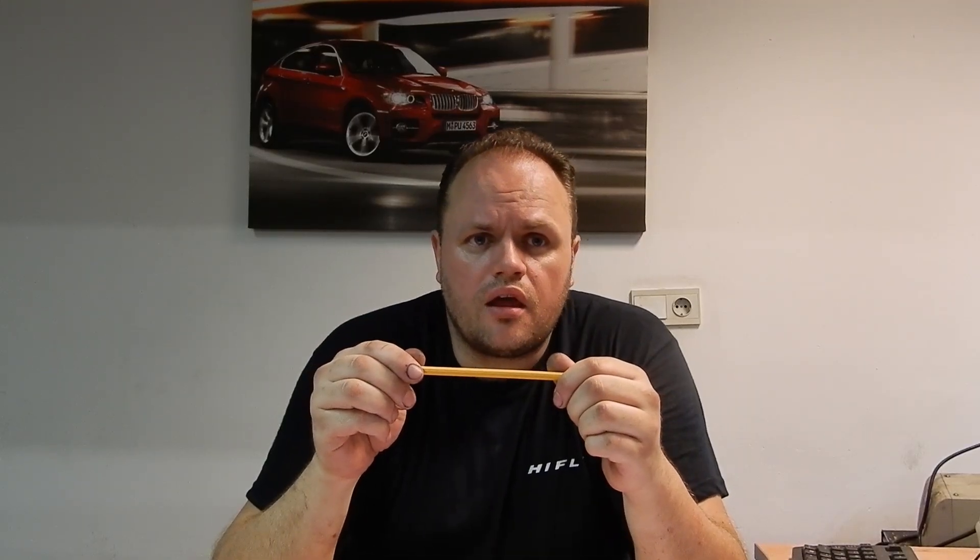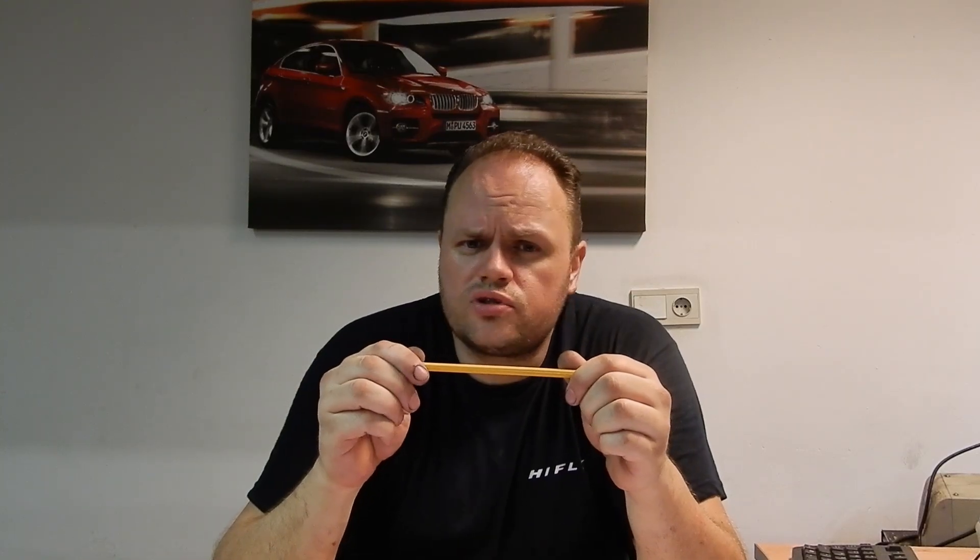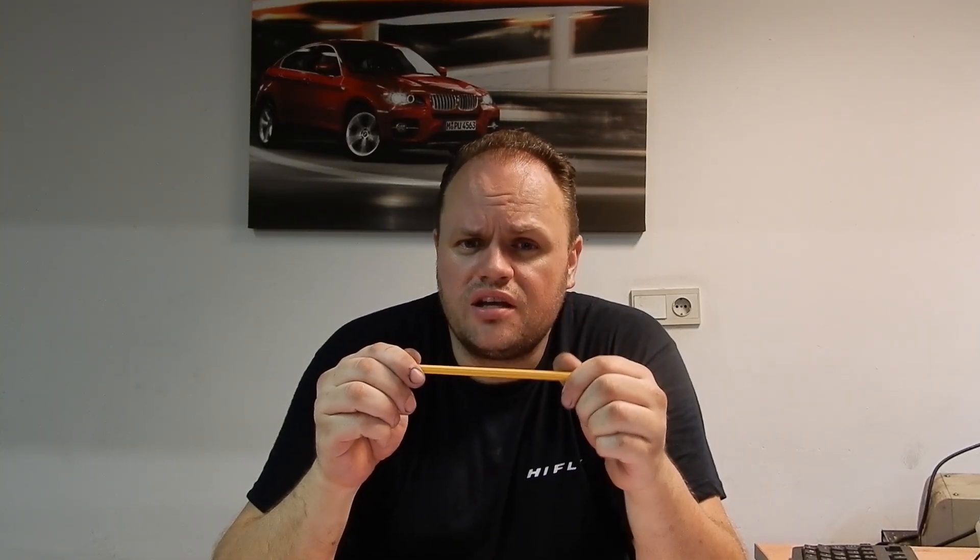Let's think about this. Remember at the beginning I said it looked like the battery was weak and I connected the battery charger — well, actually it wasn't. It was a brand new battery; the previous garage had already installed a brand new battery, and even the starter motor was replaced. Another thing I learned today: it's called a relative compression test, but we're actually just measuring the current through the starter motor, and there are things that can influence that current — like we saw today. So keep that in mind.